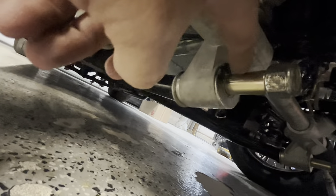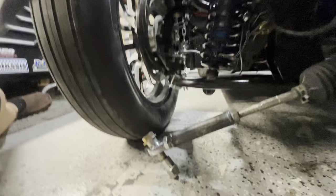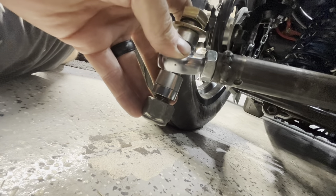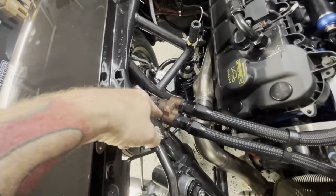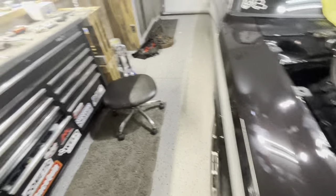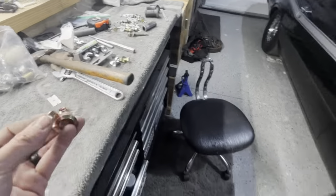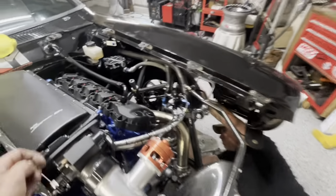I went ahead and put these on. I used a spacer because now I have shank on the bolt where the nut won't go all the way tight since we've changed to solid mounts — so this is way too long, I'll change it later. For bump steer, you have these spacers but it will only pivot so much before the spacer hits. You can order heim joints with misalignment spacers built in, but they change the bolt size from 5/8 down to half inch, and we can't use a half-inch bolt on our steering spindle — Mike said we need at least 5/8 due to the forces involved. So I ordered tapered misalignment spacers from Speedway Motors, hoping these will get us exactly what we need.